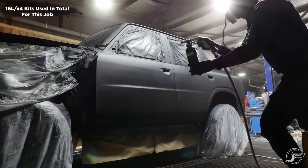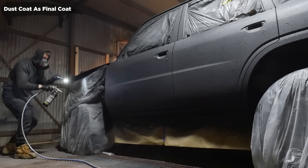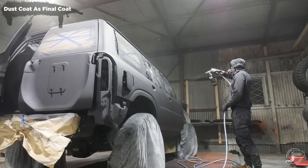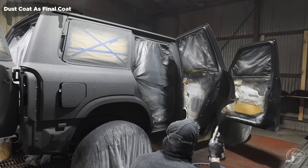I personally do four coats of Raptor Liner on anything I paint. The first coat is a light coat; the second is a covering coat; the third is the finishing coat making sure it's very even across the board. The fourth is what I call the dust coat — I stand further back from the vehicle and drop a nice even coat across the whole thing. This covers any slight imperfections and blends the finish to look very uniform. It also affects texture, so I make sure those first coats aren't too rough so the dust coat stays extremely fine. I recommend it for both finish evenness and durability.